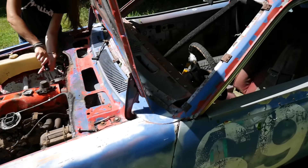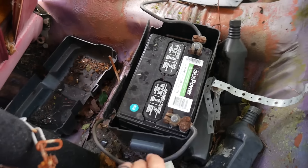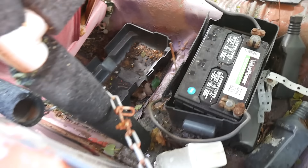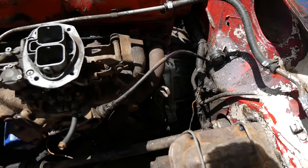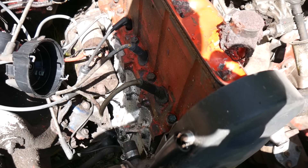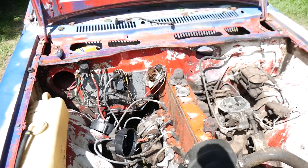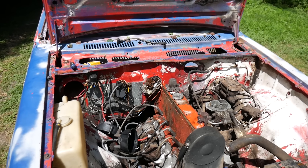Well, Jessica's finishing up that. Let's go look at the ground here. We got a really bad connector — it's just bolted to the floor pan, which basically means she just has a body ground. And if we look at the engine, unless I'm missing it, it doesn't really look like there's anything going from the engine directly to the body. Although they're solid mount-ish looking thingies. We'll try to get the meter on that and test the ground somehow.